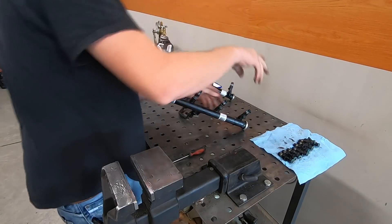The fuel trims being out of whack was because without the right amount of vacuum being applied on the back of the regulator, fuel pressure is lower than usual, which means it delivers less fuel. We went for a drive and logged the same long-term fuel trim parameters. They are quite a bit lower now — pretty much within where we want to be. A lot of these are plus or minus five. Still on the plus side, but much closer to that five target rather than being 10, 12, 15, or as high as 20. It was probably mostly the regulator that caused that, but I was happy to install the injectors anyway since we'll probably be throwing a cam in here.